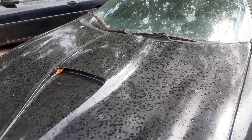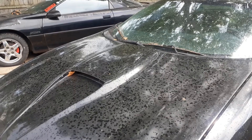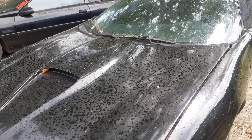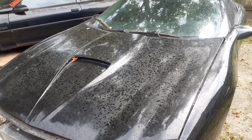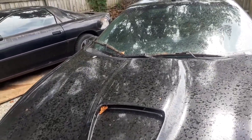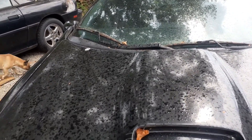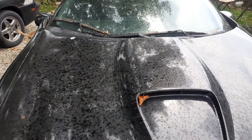So we're going to go through that wiring harness to see if we can figure out why it's doing that. The fan 2 control goes off the blue pin connector and it just all of a sudden started pulsating itself, right around the time that the car stopped revving good. I think there's a problem in that wire harness somewhere. Plus, when we tapped into the red fan 1 connector, it was stuck up inside the harness — it never should have been up there because that one's supposed to plug in on the plug-ins on the fender well. We're going to go through that harness like we did mine, take everything off that he doesn't need, and double-check everything — make sure everything's run to the ground and run to the correct powers.